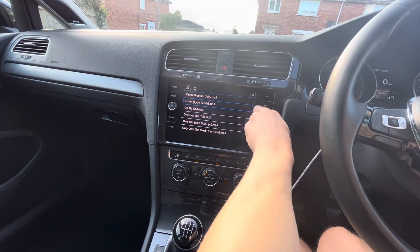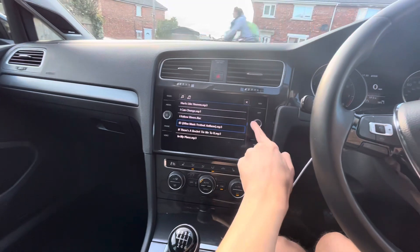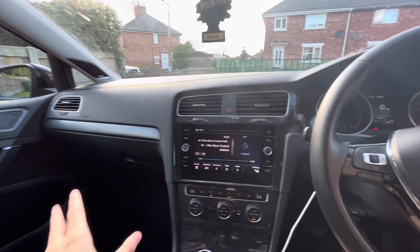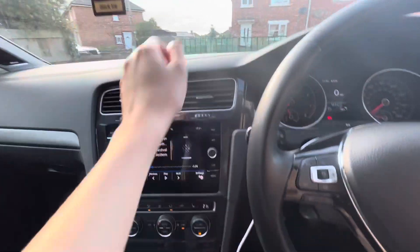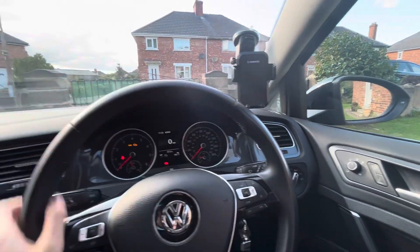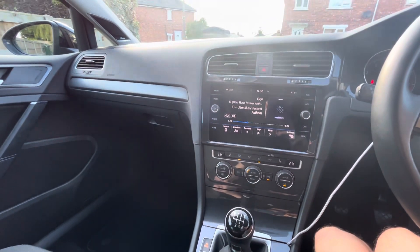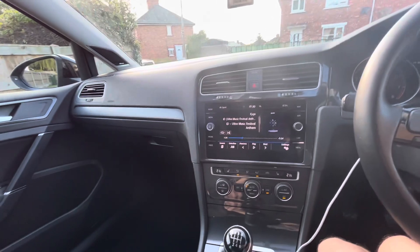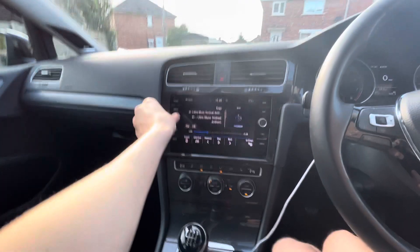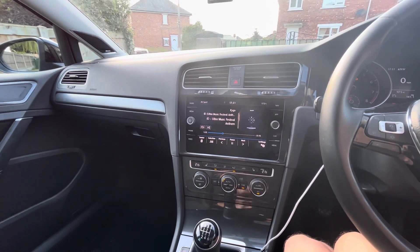I'll find a track to use as a test — this one will demonstrate how clear the highs are. On the Dynaudio system, they cross the tweeters over at 800 Hz, and I believe the reason was to try and make the soundstage come from the dashboard. However, the trade-off was that trying so hard to reproduce 800 Hz and higher frequencies meant you lost a lot of that upper treble sparkle. These Dynaudio drivers are actually taken almost directly from the Dynaudio Excite bookshelf speakers, which are crossed over at 2,000 Hz — not 800 Hz. That gives you an idea of how badly tuned the stock system was in my opinion. And this is with my tuning via the Zen.